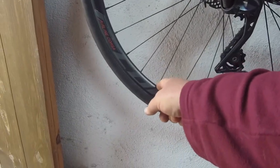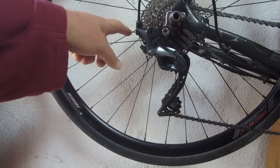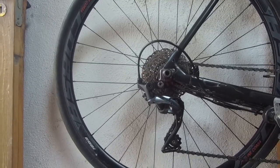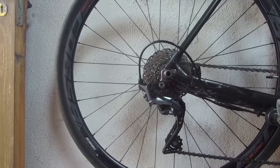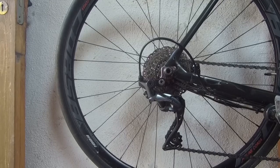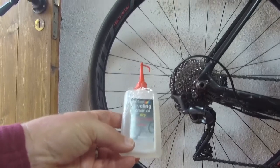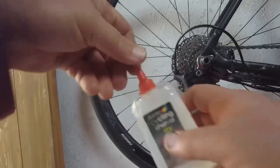Now, from what I've read, the rear wheel — if that's at fault for making creaks — it can either come from where the spoke nipples enter the rim, or it can come from where the spokes cross. Either of those can cause the noise I've got. I didn't lubricate either of those when I made this wheel, so it is quite a likely problem area. What I'm going to use for that is some chain oil, because it doesn't tend to fly off at high speeds — that's what it's designed for. It's a dry oil.